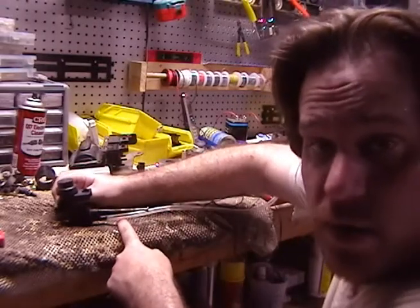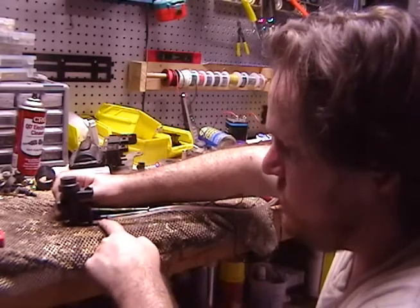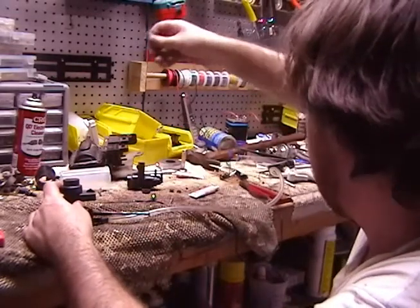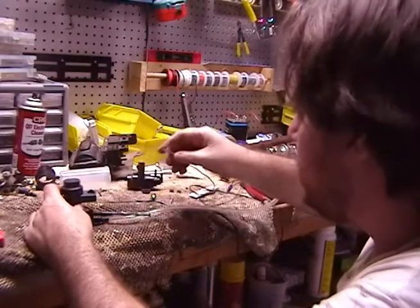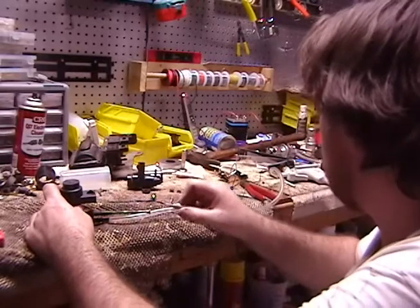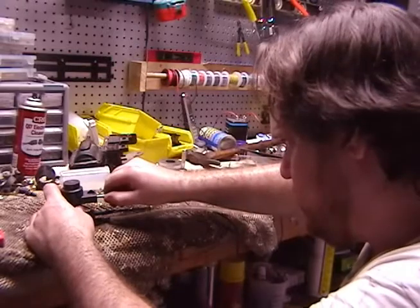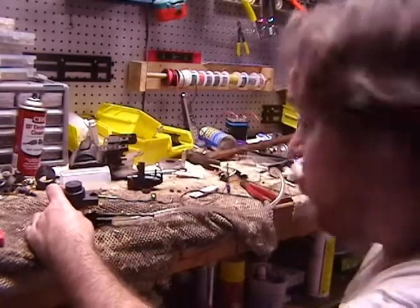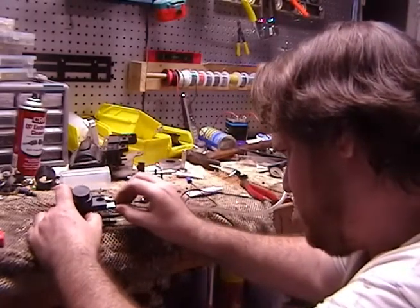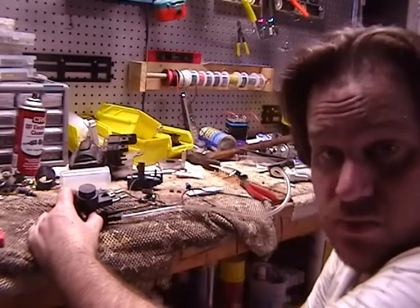The vacuum comes through this clear tube as the incoming vacuum from the tree on the upper intake manifold. The vacuum comes through here, and once this is activated by the computer - in this case, I'm the computer - positive is on the right. It needs constant 12 volts, and that might be part of my issue here.